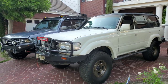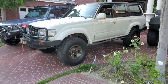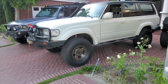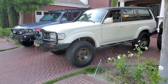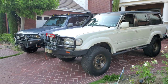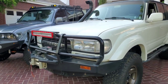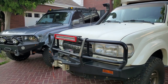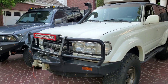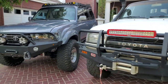Here are some of the differences. A stock model will look very similar. In 93-94, they went from conical lug nuts to the washer type, which is common on all Land Cruisers, LX 470s, 570s, and 450s. Another big change: the grille, which we pointed out at the beginning, and the headlights. The gray one has aftermarket headlights, but stock headlights have different mounting points — you could not take headlights from a 94 and put them on a 95 and up.